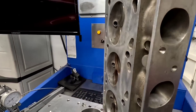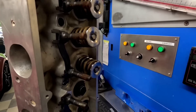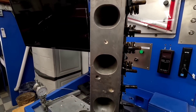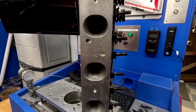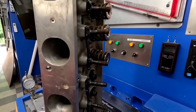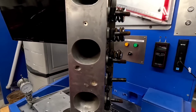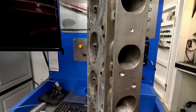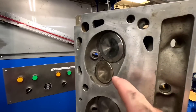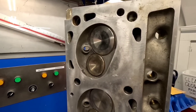As cast, from my little bit of research on these cylinder heads, they flow close to 330 CFM. Now, the mods that we're going to dive into are going to be very basic — basically what I would call a good bowl cleanup. And actually a lot of the porting is not in the port itself; it's going to be here in the chambers, de-shrouding, and using David's techniques.